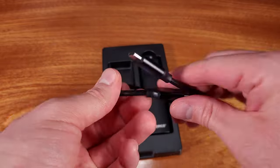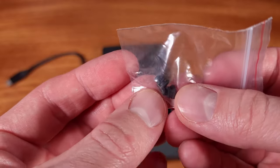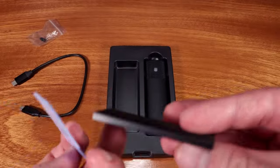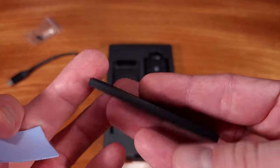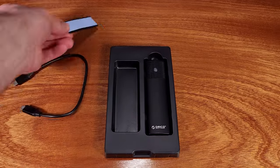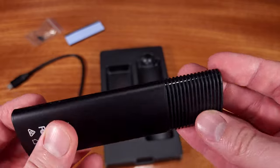The kit comes with a rubber-type screw, so you don't have to worry about purchasing or losing any standoffs or screws. A neat feature of this kit is that it comes with its own heatsink as well. So if you have an SSD that runs a little hot, or you normally put your SSD on the exhaust vent side of your laptop, that'll definitely help keep it cool.